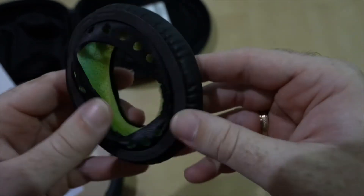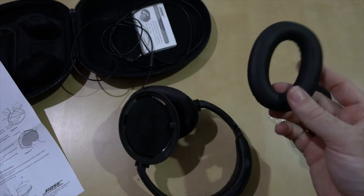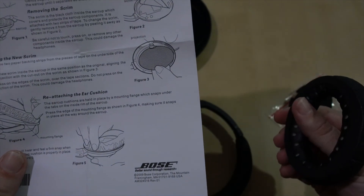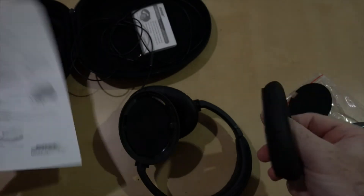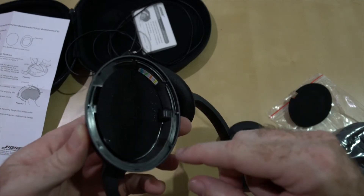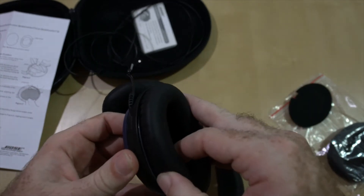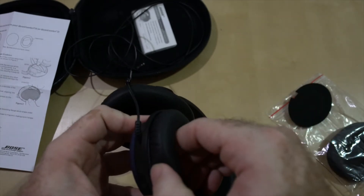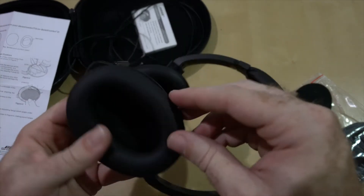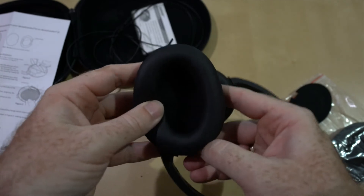There's a little buffer here. Let's take our new one — hopefully this is going to be really easy. Reattaching the ear cushion: the ear cup cushions are held in place by a mounting flange, which snaps under the tabs in the inside of the ear cup. So let's see if we can find a mounting flange here. This right here looks a little flange-y, so we'll assume that's the mounting flange. If I had some good stock music, we'd have a little carnival do-do-do-do thing while I try to do this. Although I regularly spend too much money on camera gear, I don't have a stock sound library — mainly what came with iMovie.